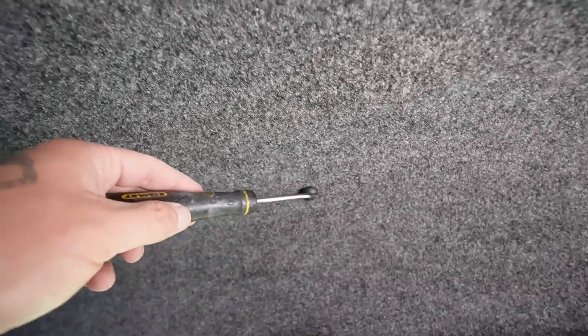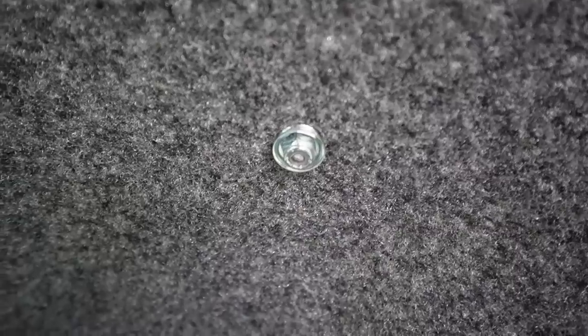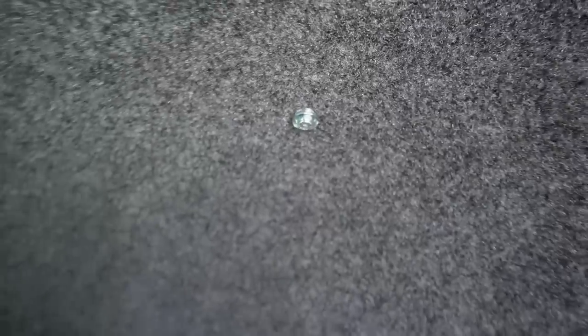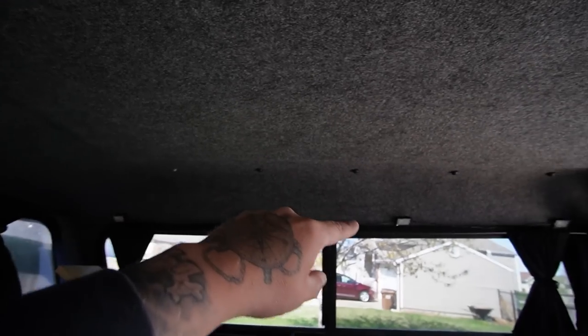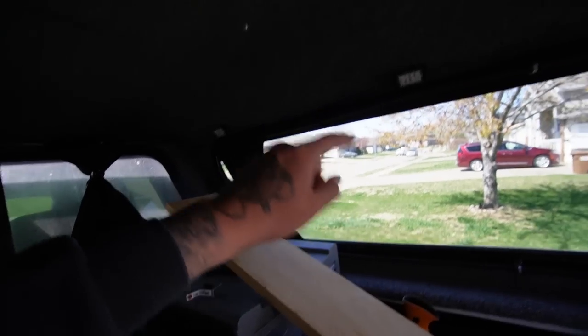As far as these roof rack bolts go, if you have these you can pop the little black cover off — it's just a little pop-on cover — and underneath you'll have the bolts that come down and hold your rail through. We're going to take that off and attach one of these brackets under there. We'll have to make some little wooden spreaders that come down, all a different length because this roof does curve a little bit. I'll have to measure those once I get the board put up, and then we'll put a trim piece around here to hold things in and run some bungees through our spreaders.